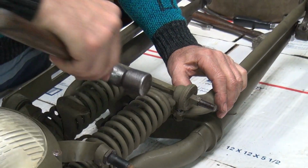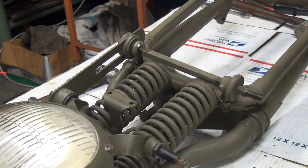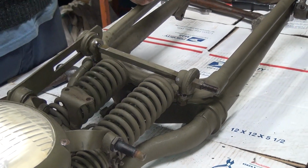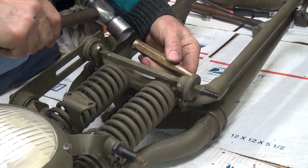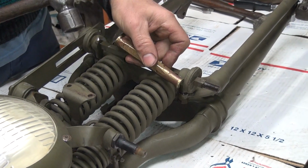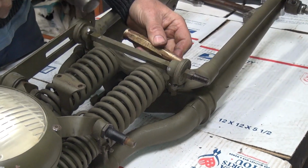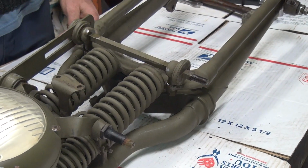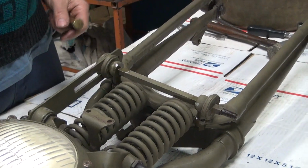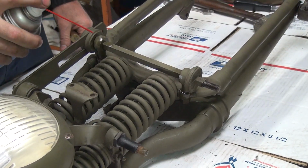Will you explain how the WLA bounces in the front? Well, on my bike, when you go into a corner doing about 43 to 45 miles an hour, the front end starts pogoing and washes out on you. So that limits how fast you can go. You can't be turning anything faster than 45 or 43 in that area. I usually have a problem when I go into a corner because I'm hauling ass, doing 70 into the corner, and it starts wobbling on you big time. You gotta slow down a little bit, and once it gets down to that speed, you're usually in the middle of the corner. So you just hammer it coming out of the corner, and it's fine.